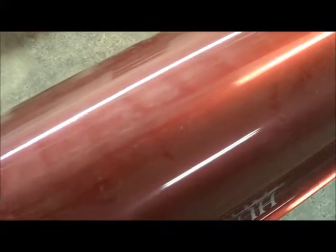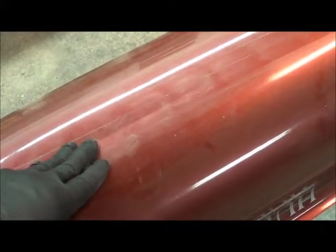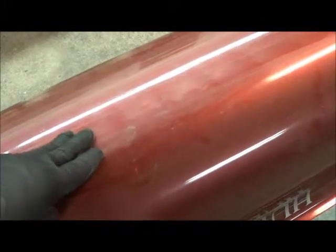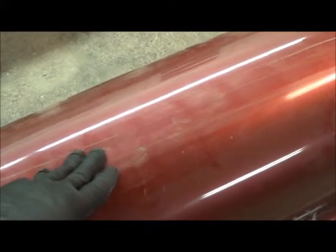What happens with these boats is that even though it doesn't look like the hull is too compromised right here, you can see when you press on it — put a little pressure — that dent shows right there. That's delamination on the interior, and that situation runs up the whole hull.